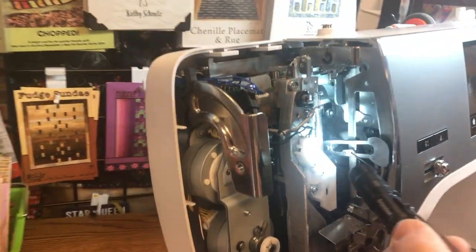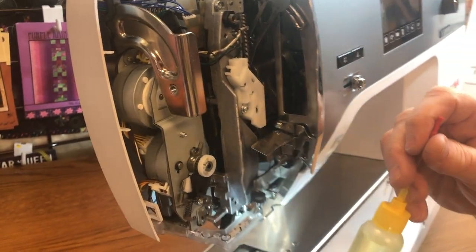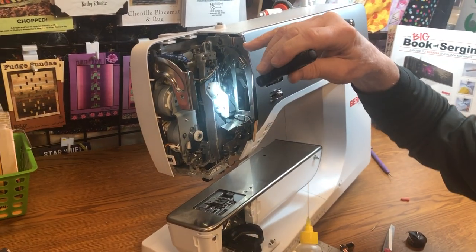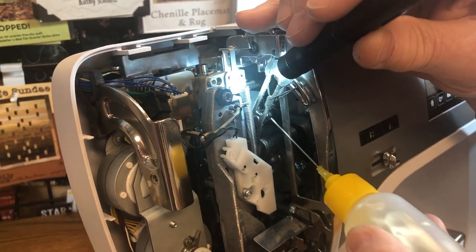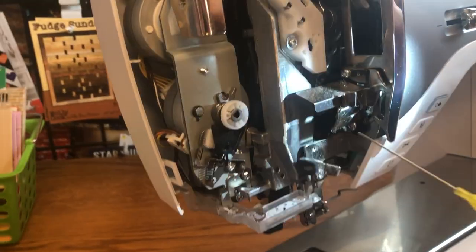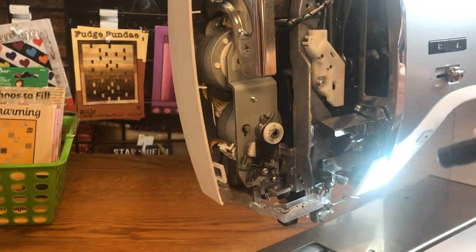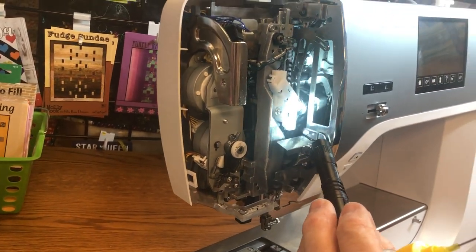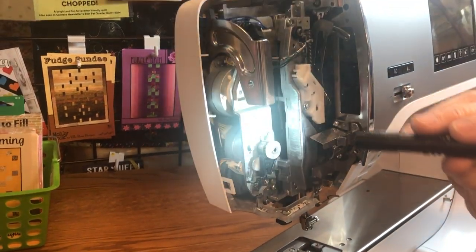While it's open, you can use your red oil. I also sell a yellow cap oil designed for any moving parts except the hook — but if all you have is the red cap oil it'll get you by. There's a crank area right here you want to give a little drip of oil, and another crank area right there. Then look at the needle bar where it goes up and down inside and give it a little drip of oil on the needle bar, because that's going up and down literally a million times. Anything that's metal on metal turning, give it a drip. The left-hand side doesn't require any oiling, so don't oil there.